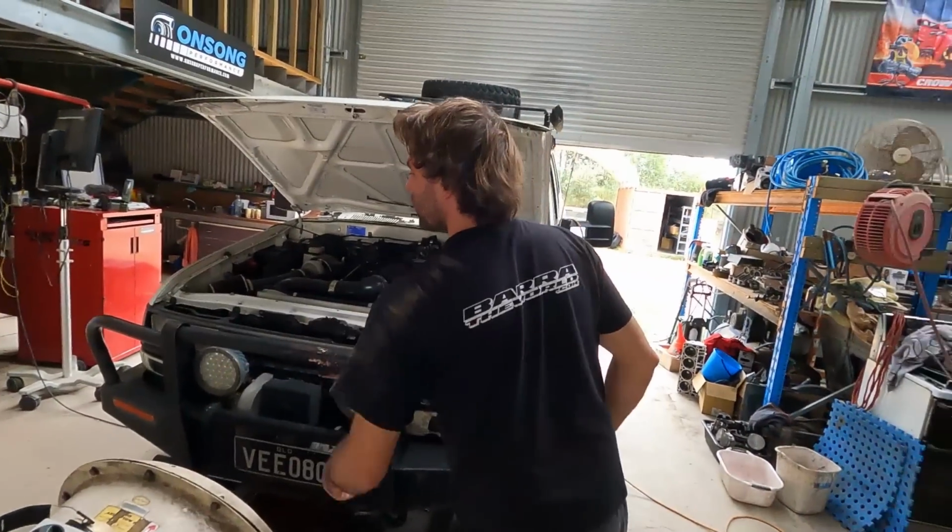Then all of a sudden, it went 486. 486, yeah. And then all of a sudden it started doing the same thing again, started breaking up. We had the multimeter on the posts in the engine bay where all the wiring goes to, and they weren't showing that it was dropping significantly in voltage, so it didn't appear to be a voltage issue. The dwell all seems to be all right, and even then that wouldn't explain why it would do it sometimes and sometimes not. Well, those leads on that side are all tied together.